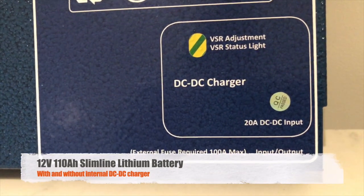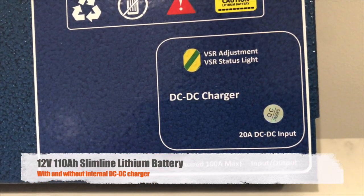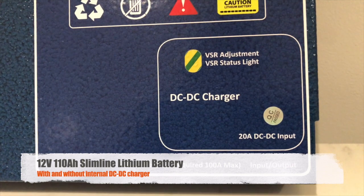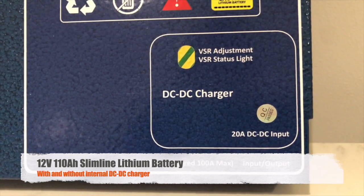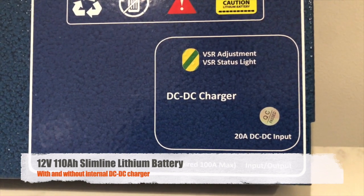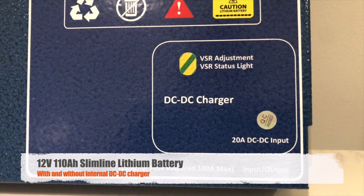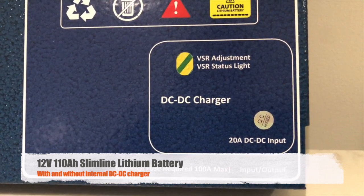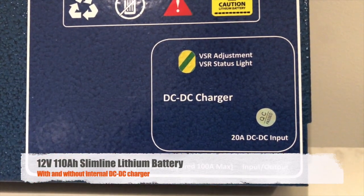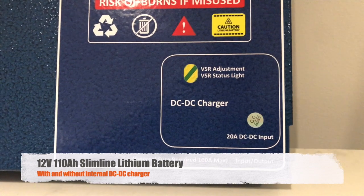And then what you do is what's called trimming the pot, or trimming the potentiometer. Underneath here, there is a small dial. So with a Phillips head screwdriver, you'd adjust the variable resistor, or potentiometer, as it's called, hence trimming the pot. And that allows you to optimize the voltage at which the charger kicks in. Because depending on how far you're away from your alternator, so this might be in a camper trailer or the back of a four-wheel drive or ute, the cable size determines how much voltage you might drop along that cable. Therefore, you might need to trim the potentiometer in order to optimize the point at which the charger kicks in. And there's an LED under here as well, which tells you when the charger is charging and when it's not. So that's really all you do. Once you've set it, it's set and forget, and you'll never have to touch it again. So that's the DCS version.